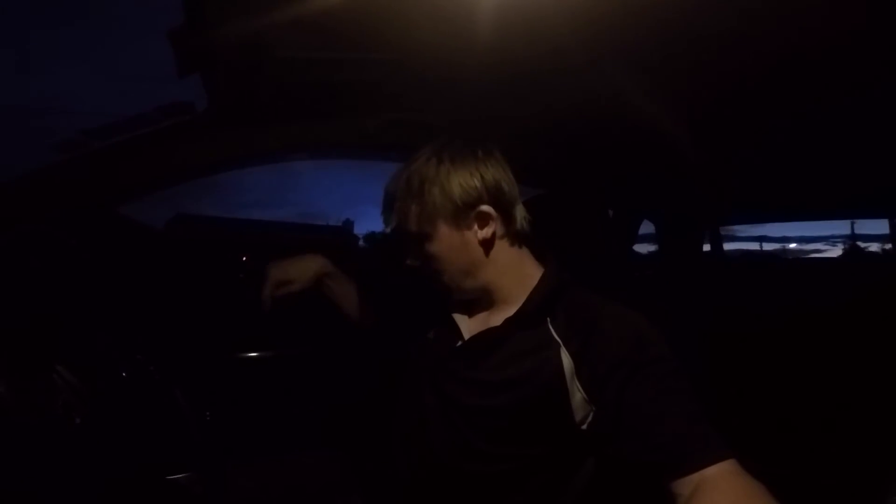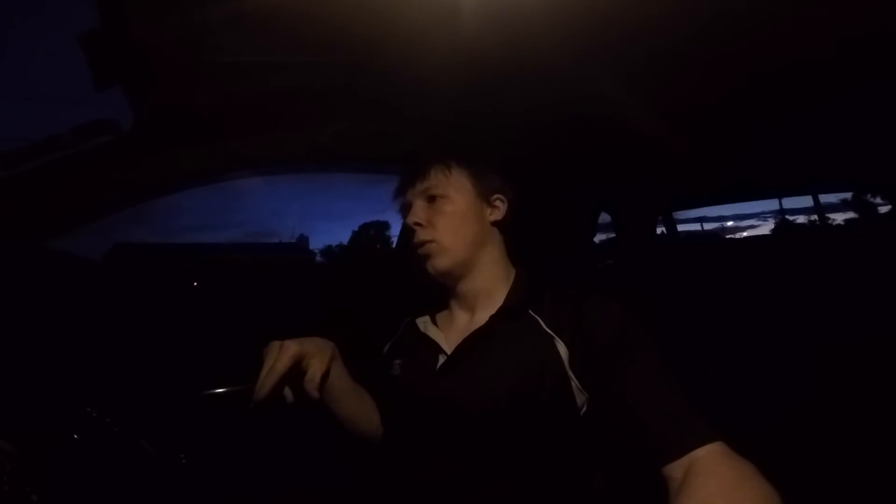My camera kept cutting out earlier. In case you missed what else I've done: I've done the footwells, the cup holder with red LEDs, the center console with a red eagle eye LED, the glove box with a red eagle eye LED, and I've put a volt meter in there too - turns on and off with accessory. I have a few more to do: a red eagle eye LED under the heater console to light up that area, and one in each door pocket wired the same way as the footwells so they turn on when you open the door or when the park lights come on. That's it from me guys - hope you've enjoyed this video, catch you in the next one.